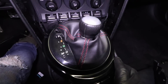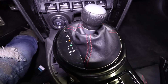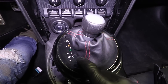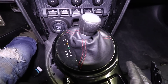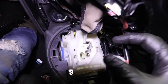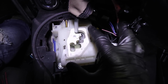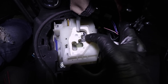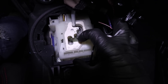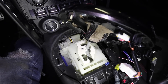Jumping inside the car to work on the shifter linkage. Up here we control the shifter, and that changes what's going on down below. The BRZ has park, reverse, neutral, and drive. The Aristo is also going to have room for three and two — if we have any chance of ever drifting this car we're going to need that ability. The length of the slots looks good, but we don't have real estate for low, three, and two, so I'm going to grab the Dremel and make some modifications.